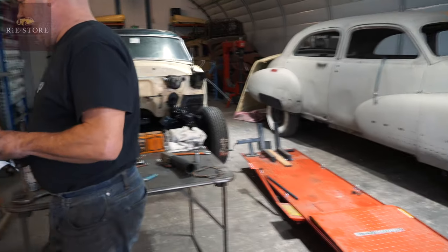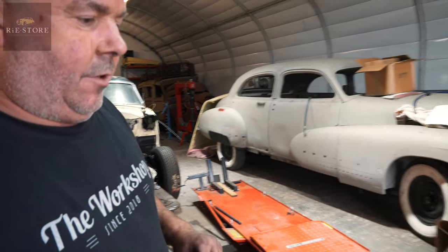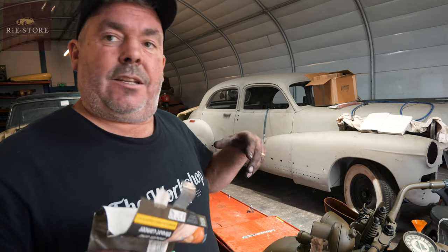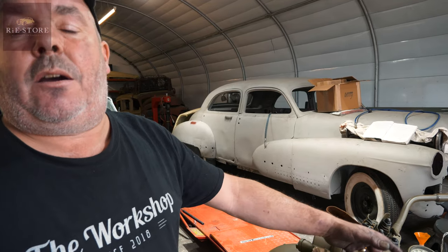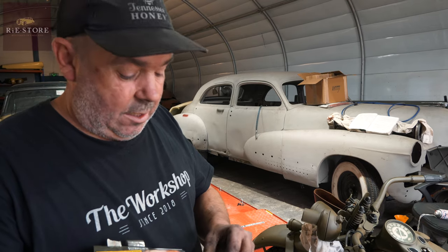Just explain what happened there with it not starting, the fuel and... So when you put it together, everything's so dry. But on the other hand, you've put oil all around the valve stems and the valve heads. So basically you've got a load of oil in the engine, your bores are fairly dry, so by squirting a little bit of WD-40 down it, you then gain suction. Okay, so that forms your suction back up. Once it's got an oil mist in it, once it's fired once, that'll just go. But I know the timing's out because of the backfire. So I'll now put it back to the points ignition, which he said he doesn't mind if we do anyway.